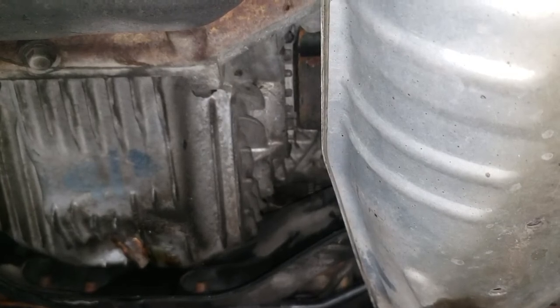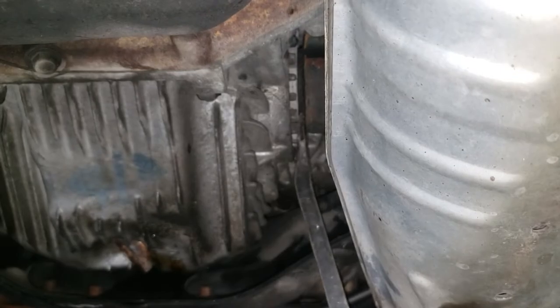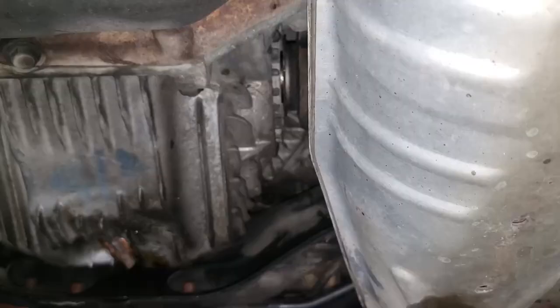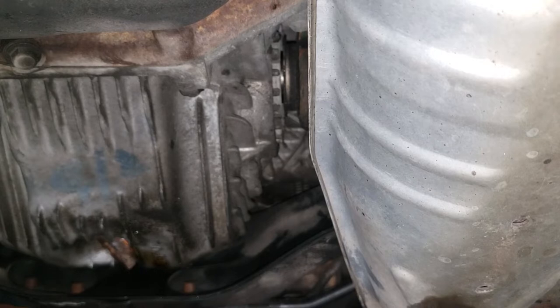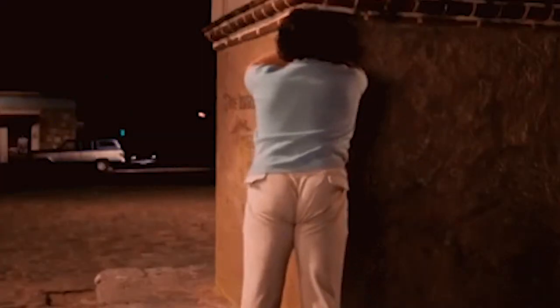On this side of the transmission here is our CV shaft and the ring I was showing you on the other side. I'm not going to remove the catalytic converter to do this job. Same principles apply — find the beefy part of the ring to pry out the CV shaft and don't go crazy on it. If you break that ring you're going to cry. If it doesn't come out easy, rotate the shaft 90 degrees and then try in the same spot again.